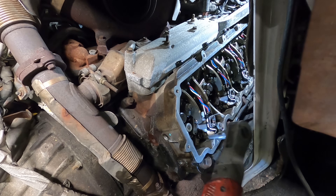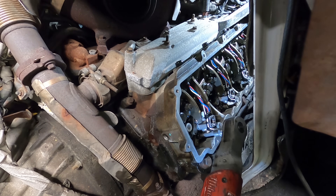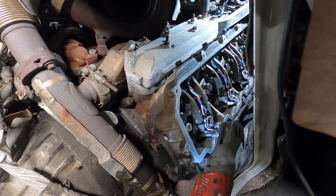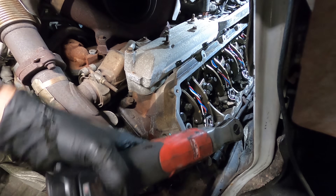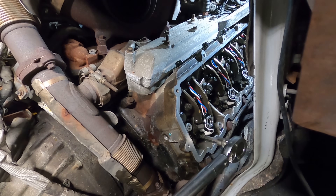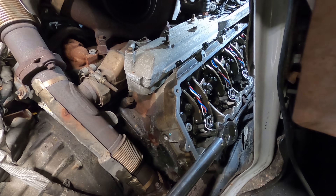If you don't feel comfortable, please switch over to hand tools. I'm just using a three-eighths electric Milwaukee ratchet — not an impact. I'm just going to draw the injector in. You're going to feel it start to get hard, then it's going to sit down and crush that copper gasket. Now I know when I torque this it's going to be a couple of good pulls on the three-eighths torque wrench — it's supposed to be at 24 foot-pounds. I felt it get tighter and then it kind of stopped, so I'm going to grab my torque wrench set to 24 foot-pounds.